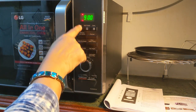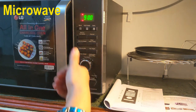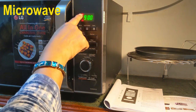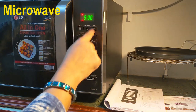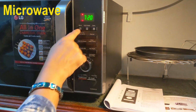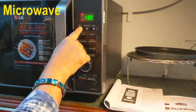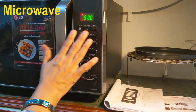First, I will explain the microwave mode. This is for cooking and reheating. As you press this button once, you get the microwave symbol and 900 — this is the power level. By default it goes to the highest power level, that is 900 watts. You can reduce it: next level is 720, then 540, 360, and 180. Once again you press, it goes back to 900. So there are five power levels.